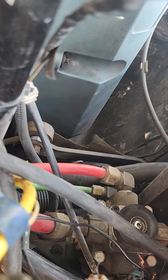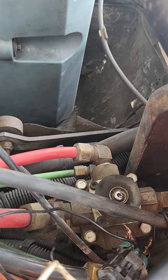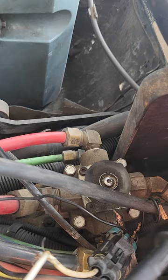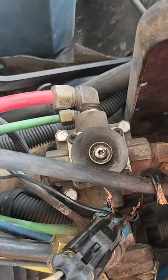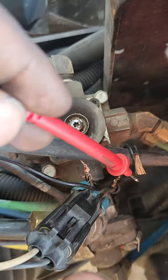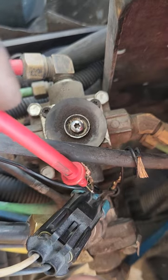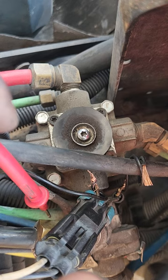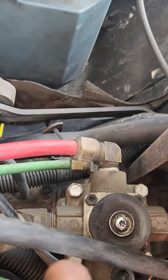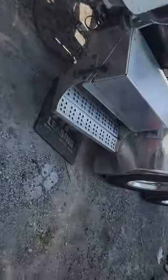So what I did is I ran a wire from the override switch that's inside and ran it through the firewall myself, because somewhere between the original wire and the override switch there's a short. Instead of taking down all those wires, I just ran a fresh wire. I cut in between the ground from the override to the actual harness right here, and ran my fresh wire all the way up to the switch inside. You hear that long beep — that's continuity. My issue was I wasn't getting continuity out of my original wire, which was causing my fan to stay on.